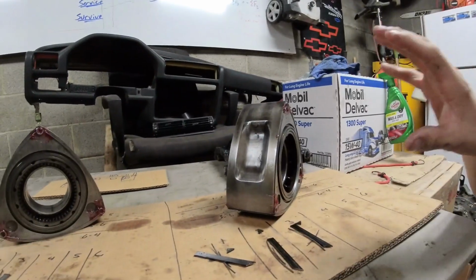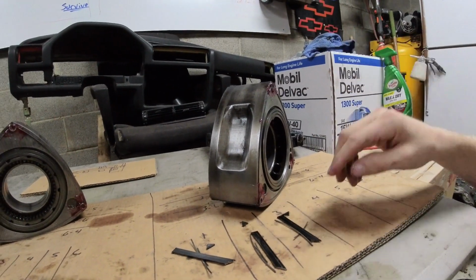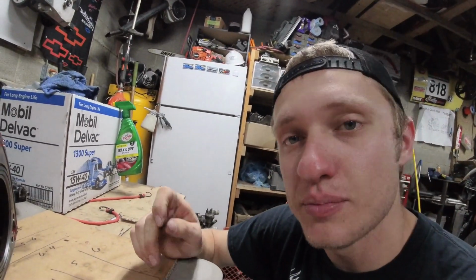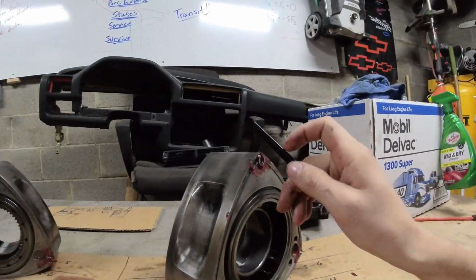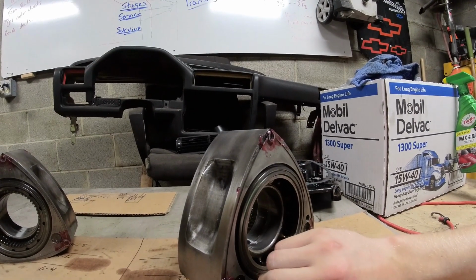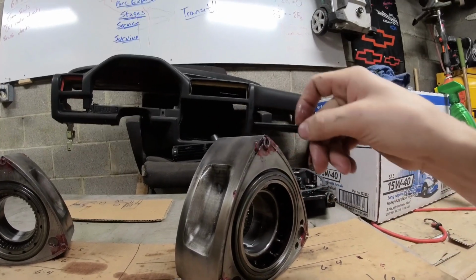It's like a checklist item I do the night before I'm going to stack the engine, because this is a very important piece, and I want to make sure all these tolerances are correct, the seals are straight, this, that, and the other. The second thing you should do on your rotors, and I'll say this a bunch of times in the video, make sure your corner seals and corner seal springs are straight, because when you go to put this apex seal in there and it gets stuck on that, that's not fun.